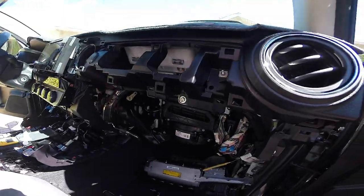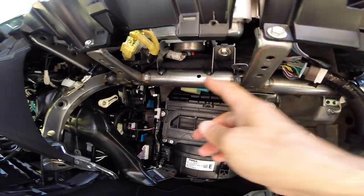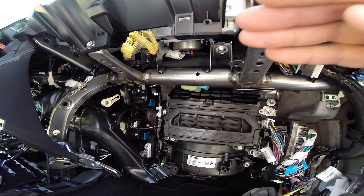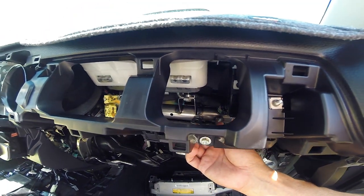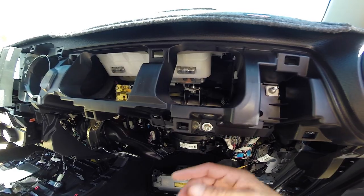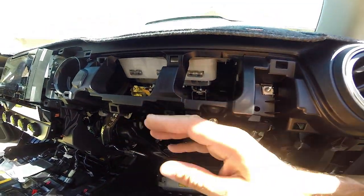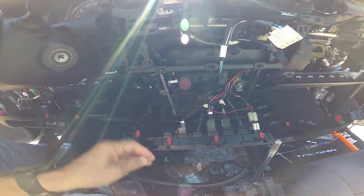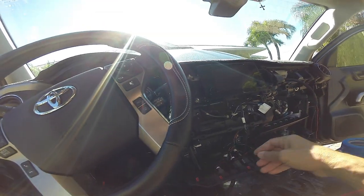I had to come back. The switch works well here — it's cleared. But you've got to make sure that when you put the glove compartment back, the light is not going to hit that. I kind of measured out exactly where I need to put that light. And there's this bracket here that can get in the way, so your best bet is to refit the glove compartment back in, drop the airbag out, refit the glove compartment in, and then take your measurements off of that. I got all my wiring done for my lights — it's very clean. Here's for my glove compartment there. Now I'm going to start putting everything back. Everything works and I'll show you the end result. It's been somewhat of a challenge, but we've gotten all around that. Stay tuned.